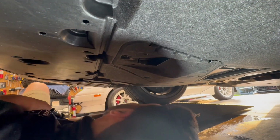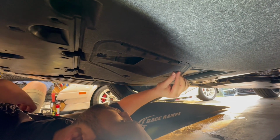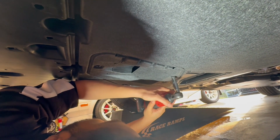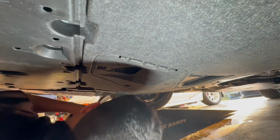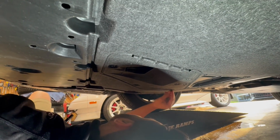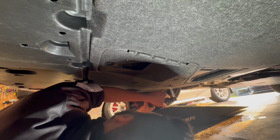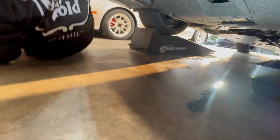It's a low torque one, so it's great for stuff like this. The tool specifically is low torque, yeah. It's only a maximum of, I think, 20-something foot-pounds. I have a higher torque one also, but for stuff like this it's great, because it's enough that you can cinch it, and you go, okay, that's good. You're not going to wreck it. But if you need to tighten it a little bit more than that, you can just turn it like a regular ratchet. That's cool too. Sometimes something will be too tight for me to break loose, and I can break it loose. So it works really well.